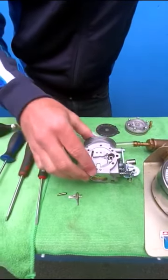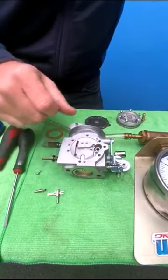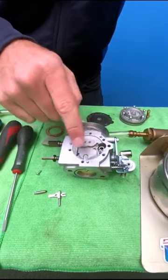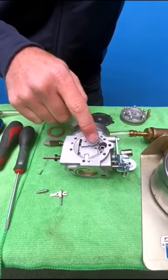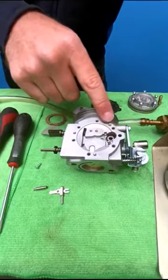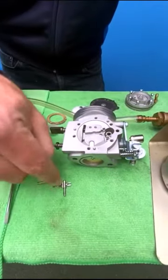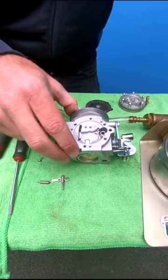At this point, to get the pressure sealing again, many people will change the needle and seat completely. But for me, it's best to clean out the seat — not to replace it initially — and to change the lever and to change the needle. So we're just going to carry that out now.